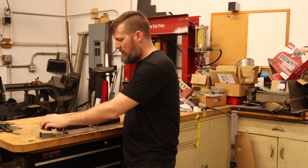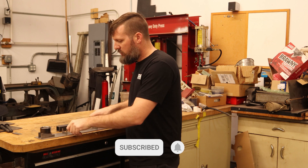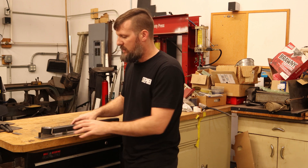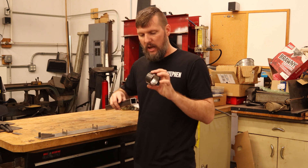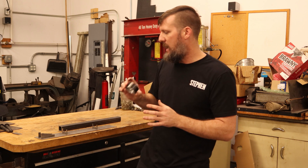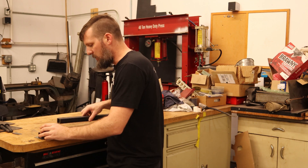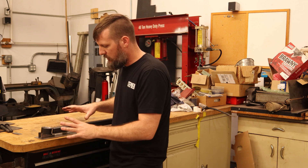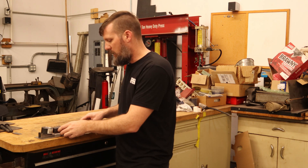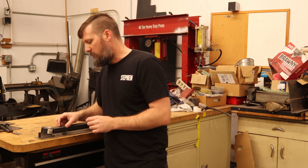What I have set up here is a jig that I made — I drew it up in Fusion 360 and got the pieces cut out. It will hold this arm and my ball joint at the angle I want. I want to put a 10-degree angle in the ball joint sleeve, and I didn't have anything laying around at exactly 10 degrees — most magnets are 30 or 45 degrees. Getting everything cut and shipped was about 30 bucks. I'll notch this arm, slide it in, and everything will be level where I want it, then tack it up and weld it.